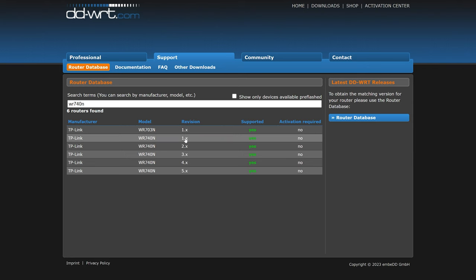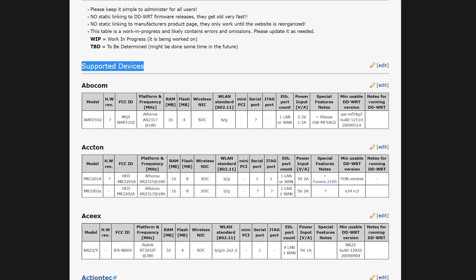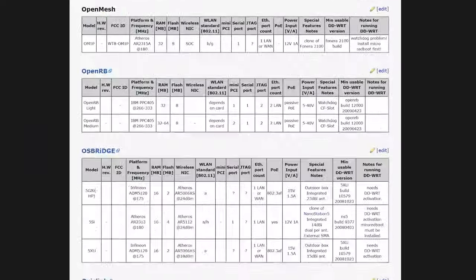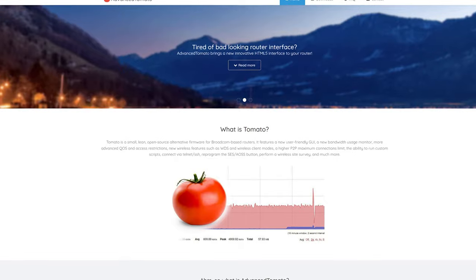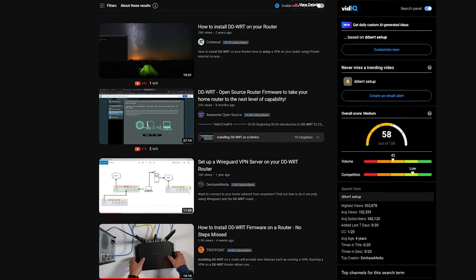Before I tell you the alternative method, just as promised, I'll show you how to add VPN functionality to an unsupported router. Your router is running a piece of software that the manufacturer flashed onto it. Lucky for us, we can change it, and there are several options to choose from — the most popular being DD-WRT. Find your router's model number and see if they have firmware for that specific model. This won't work for everyone, but thousands of routers can be upgraded with this firmware, and I was able to find used $5 routers that were compatible. If you don't see your router on DD-WRT's website, you can check out OpenWRT, Merlin, or Tomato — you might find a suitable firmware there. After that, just download the needed files and update your router using them, and you'll have the ability to install a VPN alongside a ton of other features. If you have any issues setting it up, there are great tutorials on YouTube showing you everything step by step.